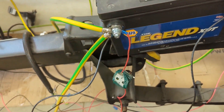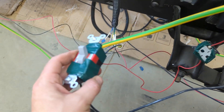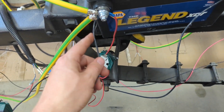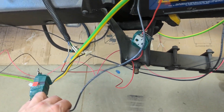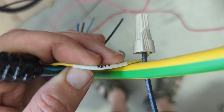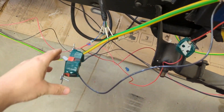We've got just a couple connections left. First you want ignition — you can see this really fine piece of switching right here. This is just like a light switch from your house. You can use anything you've got as long as it's a toggle-style switch. It comes off of here — it's black but it should be red — comes across here and goes to key positive. That is basically waking the computer, similar to taking your ignition to the run position.